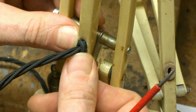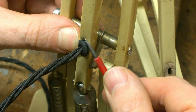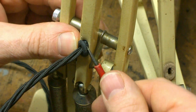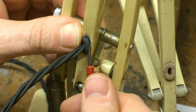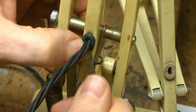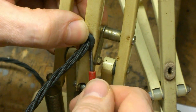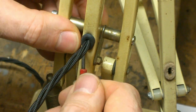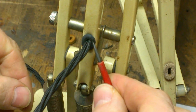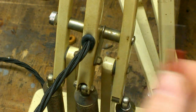You want to push one corner in, then taking a screwdriver, gently use the side of the screwdriver to ease the lower half of the grommet into the hole. Ensure that you don't use the very tip of the screwdriver as you run the risk of penetrating the rubber and damaging the electrical insulation on the cable.